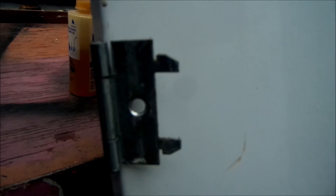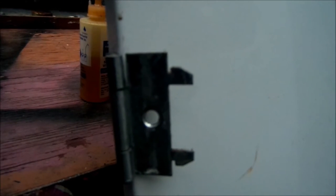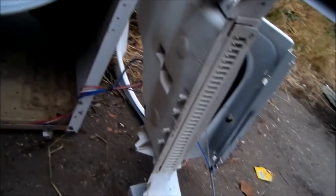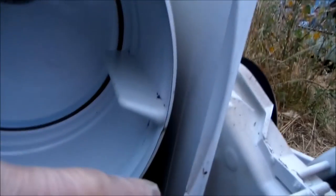On the front portion you can see the screw holes for the door hinges. The door has these little fingers or forks that sit in there, so you have to lift the door up in order to pull it out. Once you've taken these four screws off the front, you'll be able to take that front portion off, and then you need to take the screws off here and here to remove these other pieces.